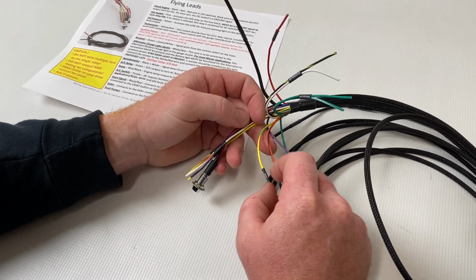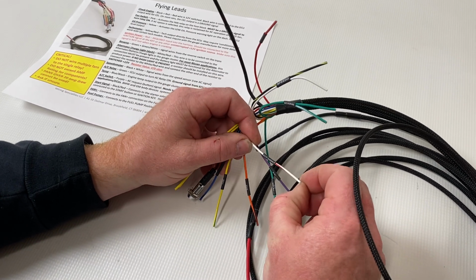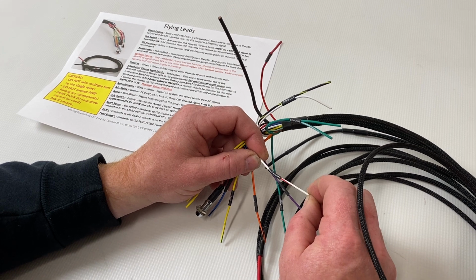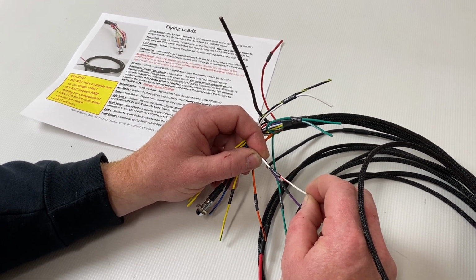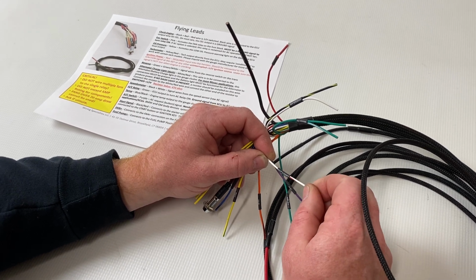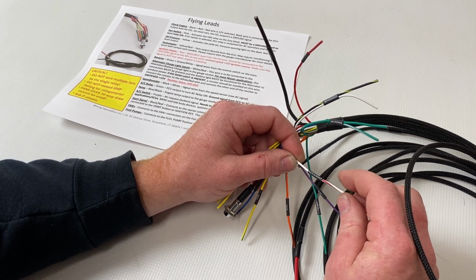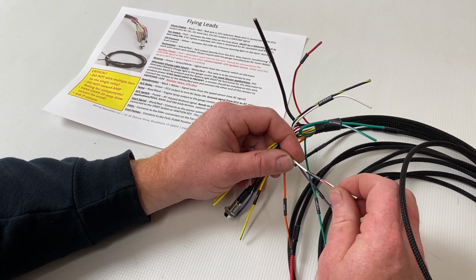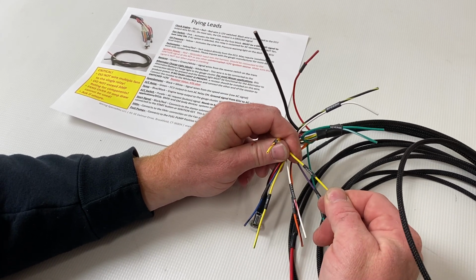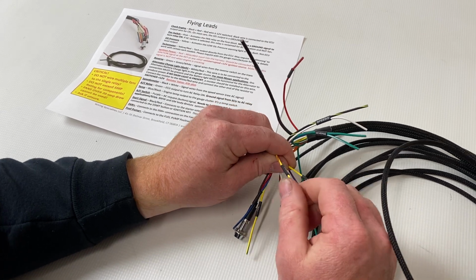So we've covered a lot of our basics here. Alternator light. This one's going to hook up to the alternator lamp on your dashboard. The opposite side of the alternator lamp is going to be 12 volt with the key on. Other things we've done is hooked up resistors instead of the lamp. We've got more information on that in some of our instructions. And then some of the other stuff, oil pressure, again, it's a pass-through. You can use it with a single wire gauge.